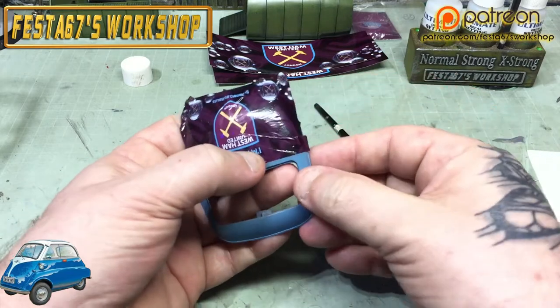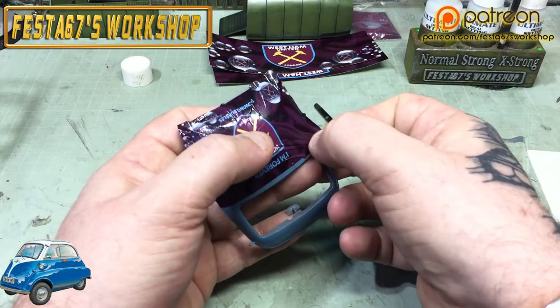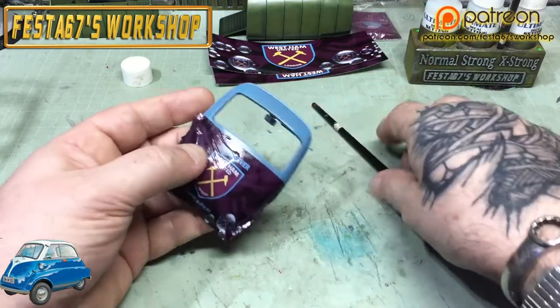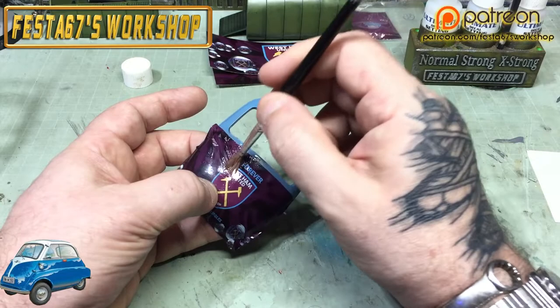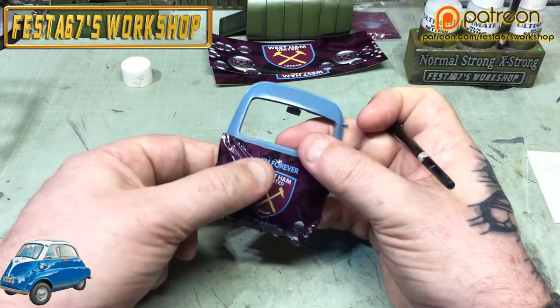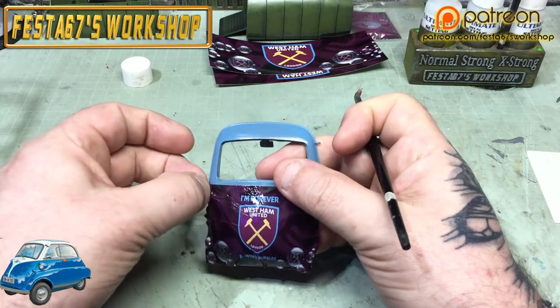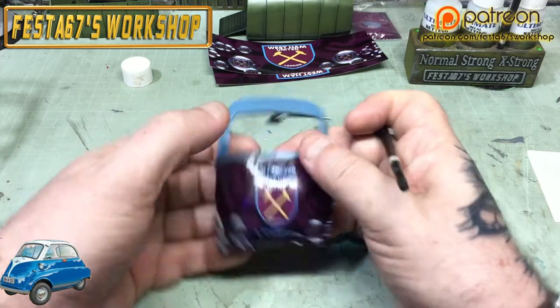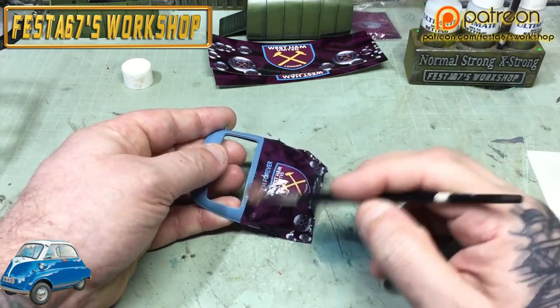So, and then I'm easing them out to areas where I can lose them, so to speak, be it in a swage line or on the top edge, and then you can go back in with your brush and move the wrinkle around until it's less of a wrinkle, so to speak, and then you can put the strong and extra strong fluids on then, and then it'll bite them into the shape you want.